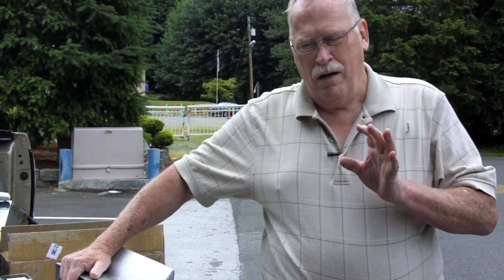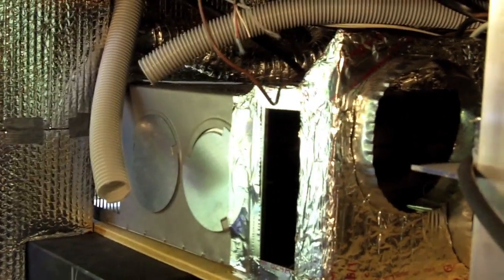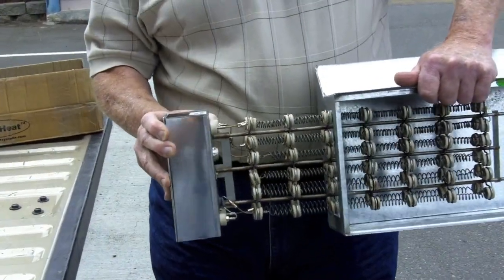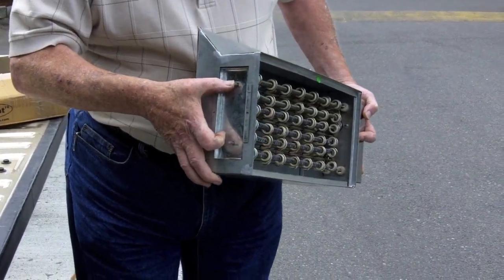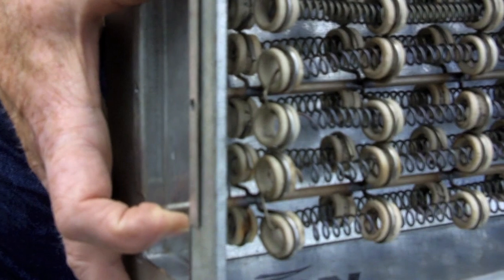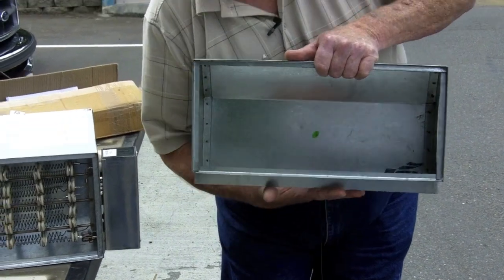What we've been talking about is the controller and the heater element. The last important piece is the add-on cabinet piece. This is the piece that actually fits on the end of the cabinet on the furnace inside the coach, so the air from the furnace blows into this cabinet. In this cabinet, we have our coil that slides inside — it can slide into this side or it'll slide in from the other side. Depending on which side you slide it in on, you're going to have this plate that fits on the opposite side that has the locking pins that slide through to support the heater element when you're traveling down the road. This one is for the ducted system that has individual ducts running off of it, and this cabinet is for the plenum system where you have the duct that runs underneath the furnace and attaches directly to the furnace.